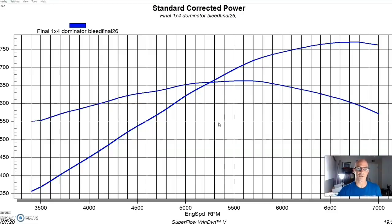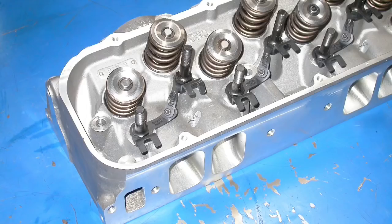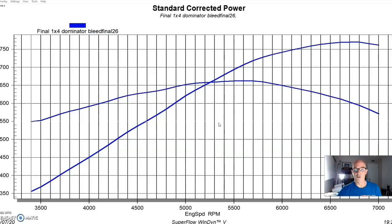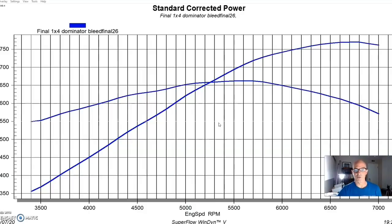We just wanted to demonstrate what would happen if you put an 871 on this 540-inch motor, which would be a good boat application. It's low compression. It has a healthy cam and obviously good cylinder heads on it. If you put a dual carb 871 on there, perfect for a jet boat or something, this thing would be awesome. Low compression, you'd have plenty of cooling from the carburetors. It's cold because it's running in a lake, and it would be a good boat motor. So that's kind of what I was envisioning for this 871 buildup.